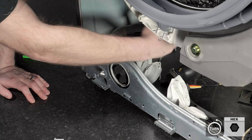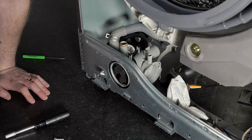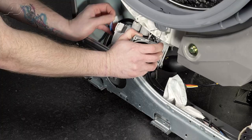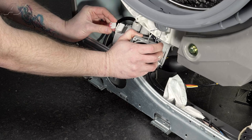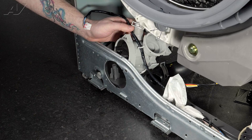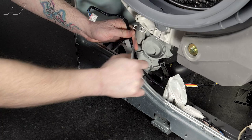Pull that out. Underneath in the back, there's a small locking clip — press down while pushing forward. Then start to lift it up. Remove the wiring by pinching and pulling out, then trail the wiring around. The last thing is the strain reliever — lift it up, slide out the wiring, slide out the bottom hose, and set your pump to the side.